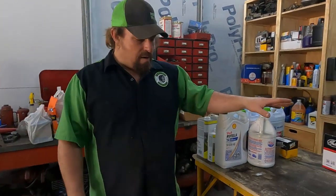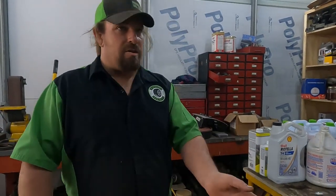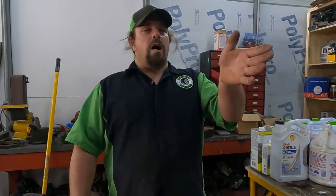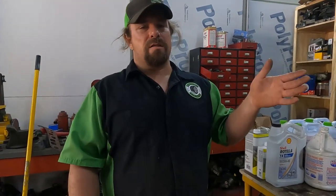We also got a water pump because the car originally had a poly 318 or an A318, and I'm guessing that the water outlet was on the other side because that's where it's at on the radiator. We need our outlet from the radiator, inlet to the water pump, on the passenger side. And currently it's on the driver's side, but with where the water pump sits, you can't see the timing marks or anything to be able to time the engine. It's just a mismatch of parts. Somebody looks like put the A water pump on the LA engine, and so it's just not gonna work out. I mean, it would work, but we couldn't time the engine and get it running right. And I have a feeling maybe that's part of the problem with why it runs so bad now.